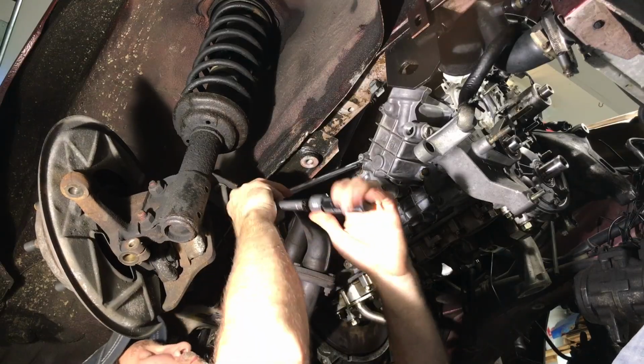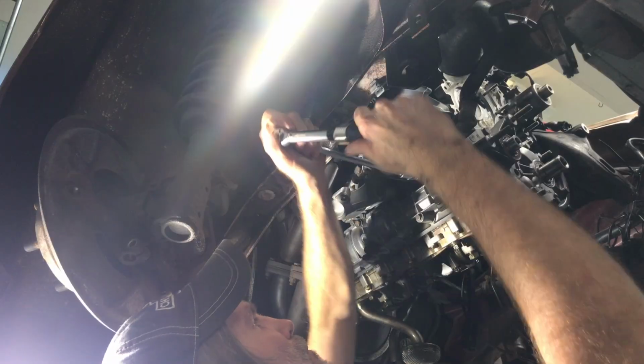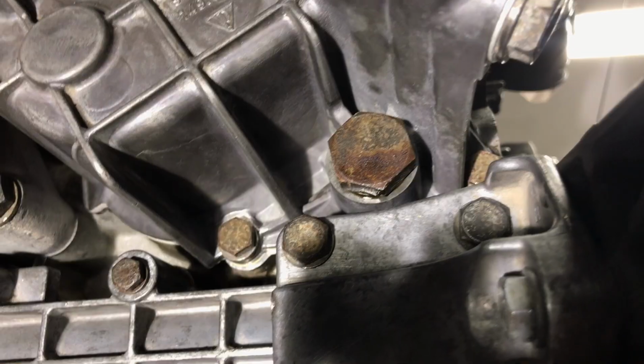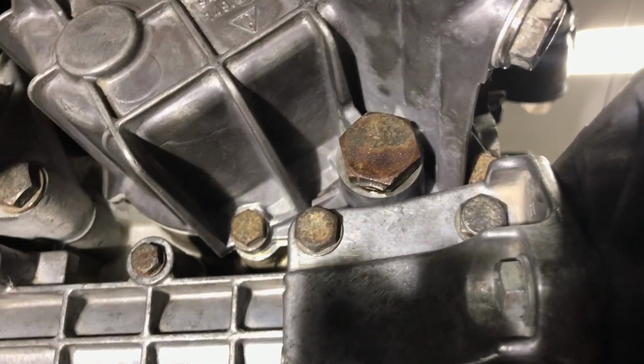I'm going to use my 1/4 inch torque wrench to torque these cover bolts to 15 foot-pounds, and then I'll use my larger 3/8 torque wrench to do the 33 foot-pounds on the oil relief valve. I started with a long extension, but then to make sure that the torque was more accurate, I went back with a shorter extension and redid the bolts one more time just to make sure. Then I just torqued the 24 millimeter head on the oil pressure relief valve to 33 foot-pounds.